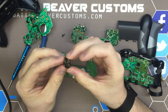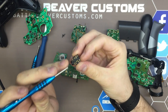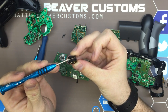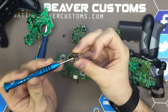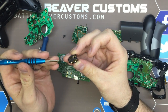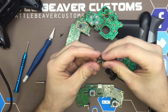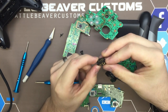Something to notice here is the number of points that this headphone jack supports. This first one is typically going to be your ground point — usually they run two. From there you'd have one, two, three, and these back two are possibly the same — four total — which would be stereo left, right, your ground, and then your microphone. It's full stereo, supporting left, right, microphone, and ground.